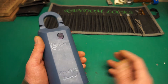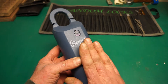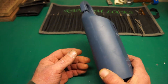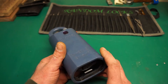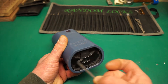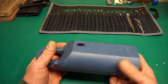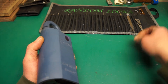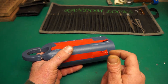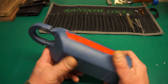Even though I am proficient in electronics, I am not a coder. I'm not going to sit here and try to hack the Bluetooth — that's not what I'm into. What I'm curious about is whether I can create a bypass. I've jammed some pretty thin stuff up in there and got it almost to the top. My guess is there's a motor actuating a cam — an offset cog that pulls in a couple of bearings to allow it to open. Unless you can get into that area, it's probably not going to open, but you never know.